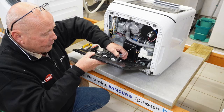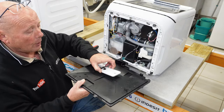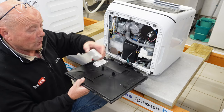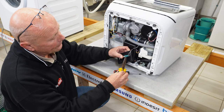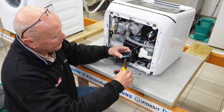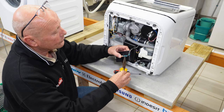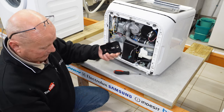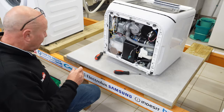You can now see the float switch — it just clips into place. Carefully press down the tabs and the float switch will come away, revealing the polystyrene float that rises when there's water in the base. You'll need to press the locking pins down to release the electrical connections. That's a perfectly good float switch which I'll set aside with the polystyrene.